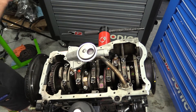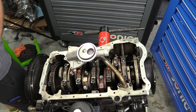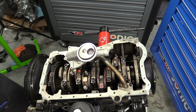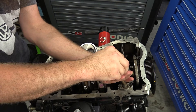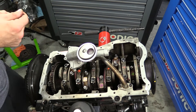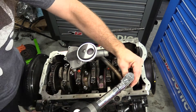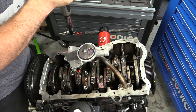This is not a place we want to make any mistakes. You can also build your own pressure setup, which a lot of guys do. This is where we use a device to actually push oil through the system. I've seen everything from a pressurized soda bottle to one of those pump-up sprayers you'd use for fertilizer or bug spray. Filling that with engine oil, pumping it up, taking out an oil pressure sensor, and pushing oil through the system is a really good alternate method to do that intermediate prime.